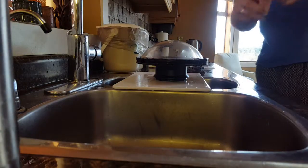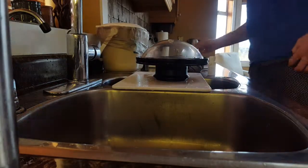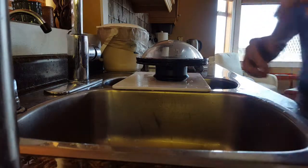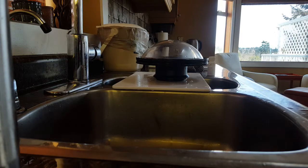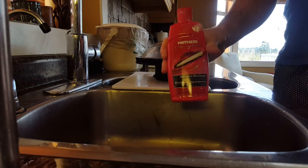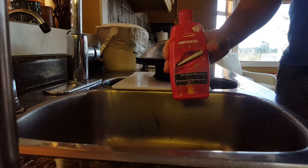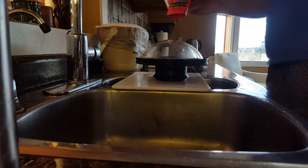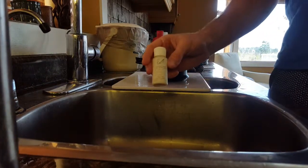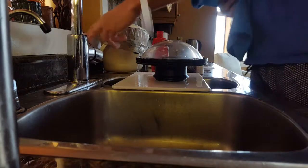This is basically just car polish. You can use car polish or Ikelite Scratch on that — for that I'll need a microfiber towel. This scratch remover is basically car polish, probably a little bit more abrasive than normal car polish. It's a cream that helps get rid of the haziness on polycarbonate, including the headlights on your car. This is the stuff that comes with the kit, so I'm going to try that first. If I'm not satisfied, I'll go ahead and use the car polish.